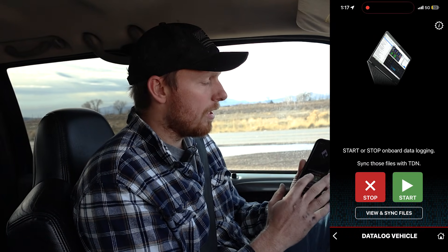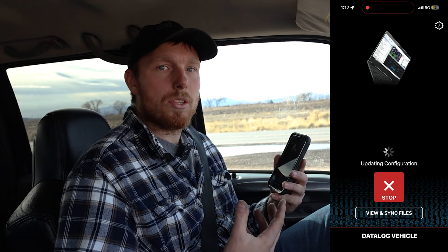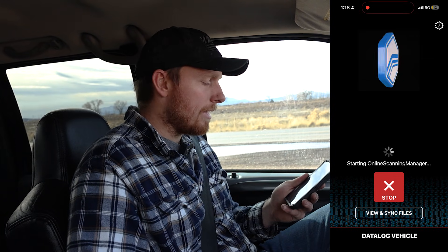This is custom tuning, so we can make changes anytime. If there's something you don't like — shift timing, a weird noise, whatever — go on that same TDN app, click 'Data Log,' click Start, start your engine, and once it connects it will data log the truck so the tuner can see exactly what's going on. Whatever you want changed, communicate that while using the data logging so we can really see what's happening. That uploads and sends it to us. That basically concludes this video — if you do have questions feel free to call in to our technical support team. And as always, like, share and subscribe to help us make more content like this. Thanks guys!